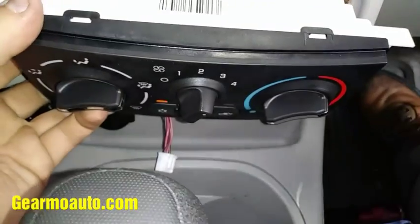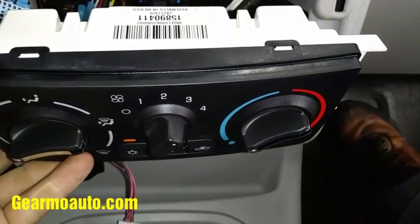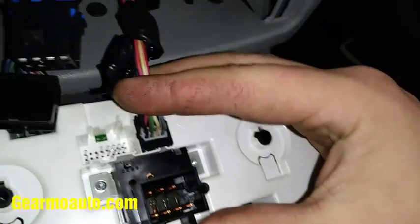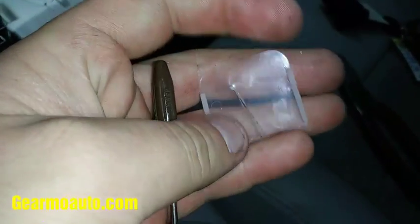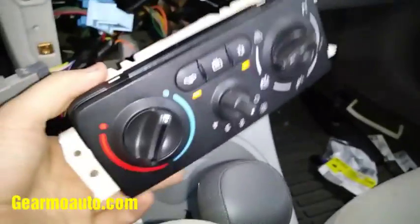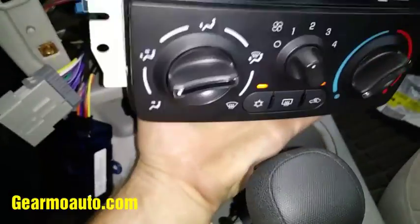So basically, this is my problem. What I found out is that when I would hold this a certain way, the snowflake light would come on — if you look at the snowflake button, you can see it's popping on and popping off. What I found was that there was a loose pin in this connector. As you can see, this connector is like a connector within a connector, and it has a lot of free play. So I made a little plastic shim and stuck it in here to reduce movement — I cut a little shim out of something I found in the car — but it was still not working right. I found that when I twisted the wire harness just a little bit, it put pressure on the bad pin.